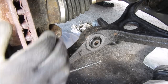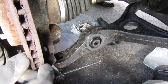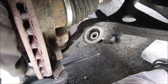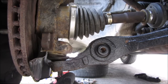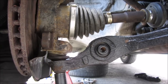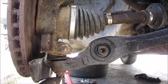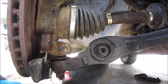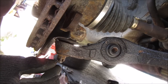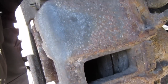Before putting the lower ball joint on, make sure you don't maneuver the steering knuckle and pull it out too far — that will pull out the inner CV boot, like what I did. Lift the steering knuckle and guide the lower ball joint into the control arm. Install the castle nut on the lower ball joint and tighten with a 17mm socket. If the castle nut spins because the ball cone isn't seated, jack the control arm up to apply pressure. Then replace the cotter pin. I also replaced the brake caliper which I had removed to get a better sight line.